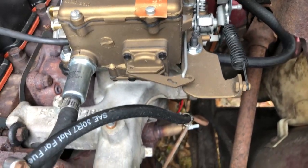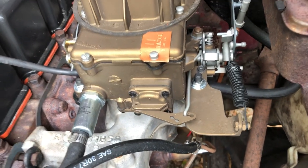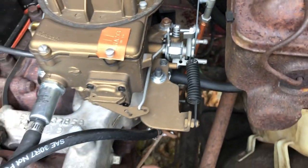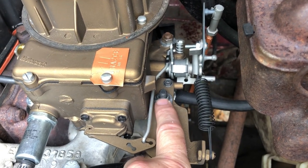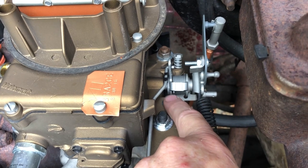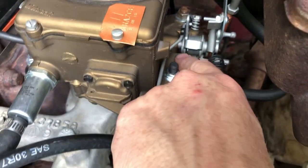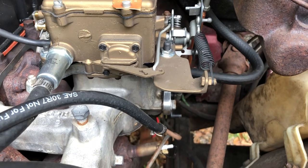One of the things you're going to have to do, whether you go 2100 or 2150 with a rearward pull throttle, is make or come up with a throttle return spring bracket. This is pretty simple — it's a piece of cut-down angle iron using the existing carburetor mounting hole and the throttle bracket mount point from the original throttle return spring bracket screw. That's all there is to it.